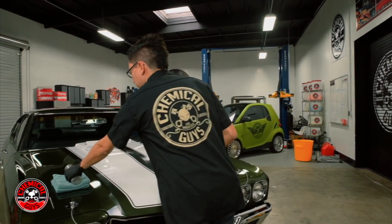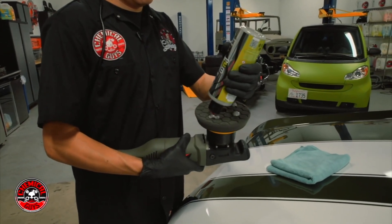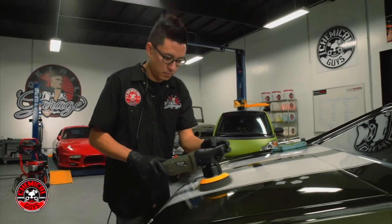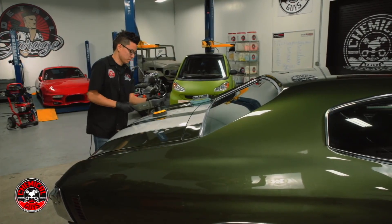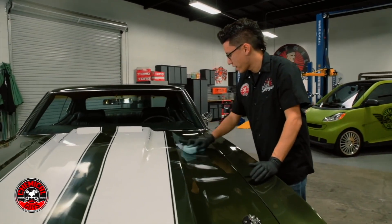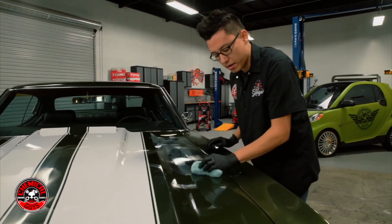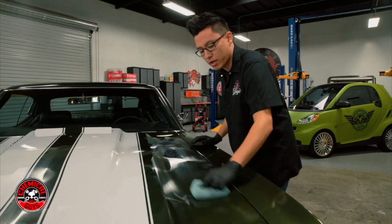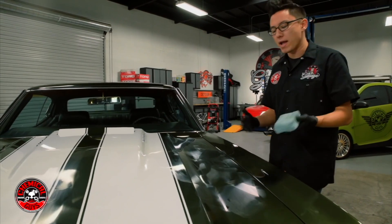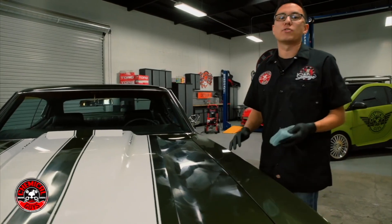You can apply Slick Finish either by hand if you don't have access to a machine polisher. If you want a little extra cutting power to take care of heavier duty water spot stains or heavier swirl marks, you can actually use Slick Finish on a machine polisher. Put it on any dual action polishing machine and work it in with a fine finishing pad. You should go on speed setting 4 and no higher than speed setting 4 — that way you can work it in a little better, take care of any deeper defects, and spread it over your whole car in just a couple minutes. If you go by hand it might take a little longer, but if you go by machine you can take care of it in no time at all.